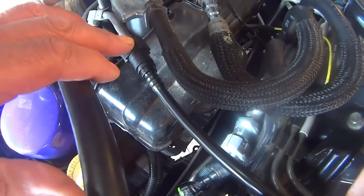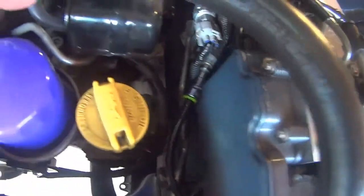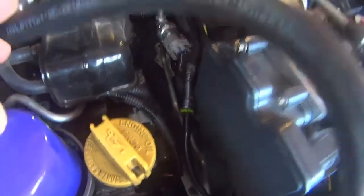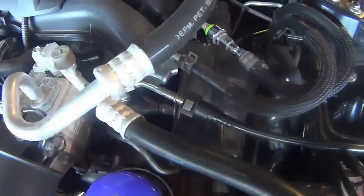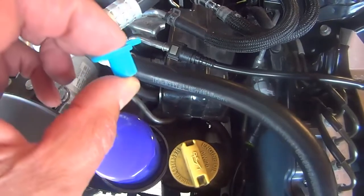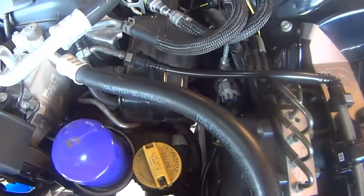Basically what you're doing is you have these three fuel lines and you're interrupting the first fuel line. Their pictures look a bit confusing, but just take this fuel line right here, route it down and bring it up, and connect your other fuel line in like that. You'll use this little plastic fuel line tool — it just clips on the line and that line pops right off.